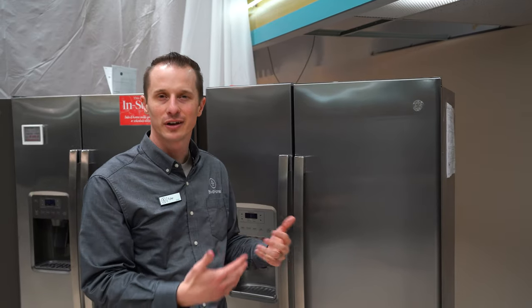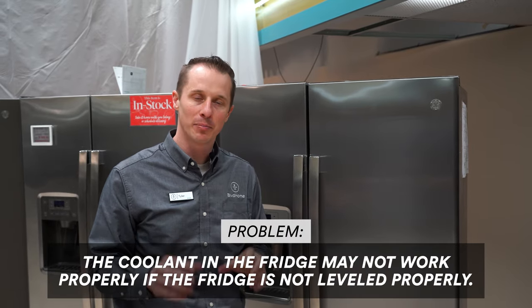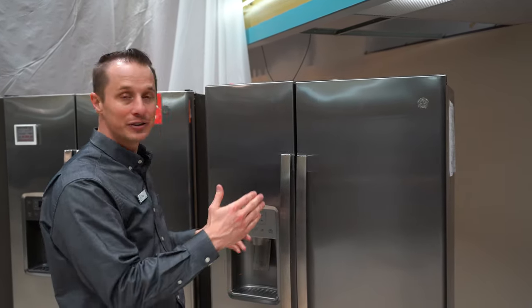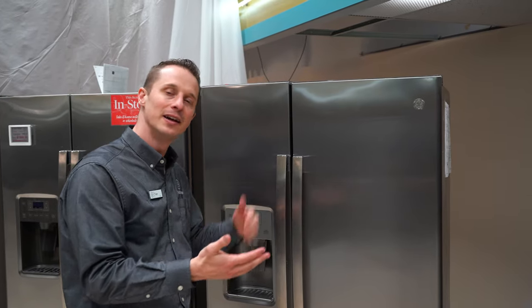One is look — it looks off, and that's an issue. However, there's more to it than that. The coolant inside the refrigerator may not work how it's supposed to if the refrigerator is not level. Most refrigerators are recommended to be tilted slightly — they want to be about a quarter inch higher on the front than the back.